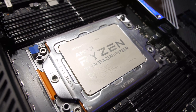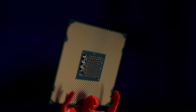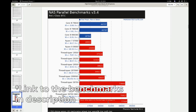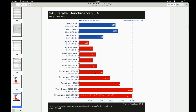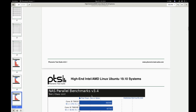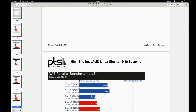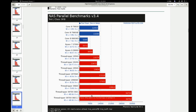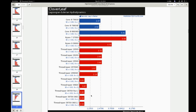That CPU is 4.8 GHz on one core out of the box, and it's a nice CPU if you're into Intel — basically plug and play. The 3950X is faster than the 10980XE out of the box. The 10980 is not faster than the 3950X, an AM4 CPU with its dual-channel memory configuration and relatively modest motherboard lineup — it's running circles around the 10980XE for most things, except AVX-512 and some other areas. If you're into scientific applications, there are some outliers like MATLAB. The MATLAB performance on Intel is a little misleading because MATLAB actually misdetects AMD CPUs and doesn't think they're capable of AVX2. If you tweak MATLAB, it'll claw back the performance and all of a sudden AMD is on a level playing field — and Intel versus AMD on that 3950X isn't looking too good.